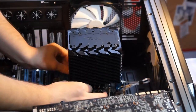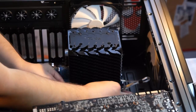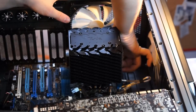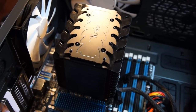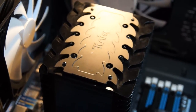However, the hard part is screwing in the thumb screws for the cooler underneath the massive cooler. You'll probably want to do this before you mount it in the case, as cramming your hands underneath the 120 Extreme — especially in smaller cases — is sort of impossible to do without getting cut a few times, so do keep that in mind.